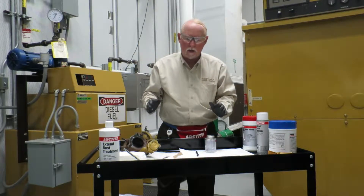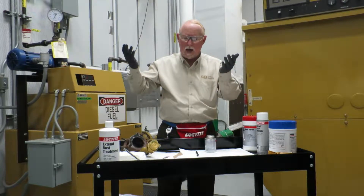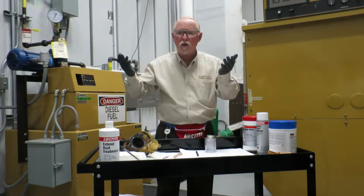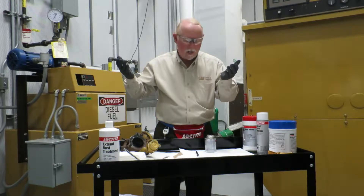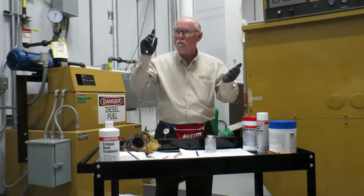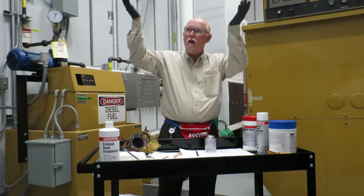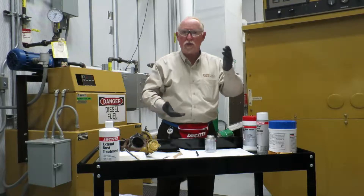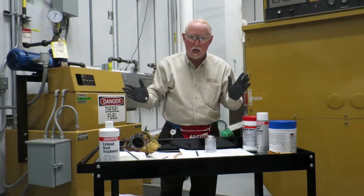If you use it on a belly pan and you're putting it up against the bottom of the block, and you're using it more than as an adhesive — you're using it almost more than a bonding agent, you're using it as its own gasket — it's not a form of gasket. What you need to do is just take it and put little dabs up there, then put it up, it'll hold it, then you can put the two pieces of metal together. But any time you use this metal to metal, it's not a good idea.